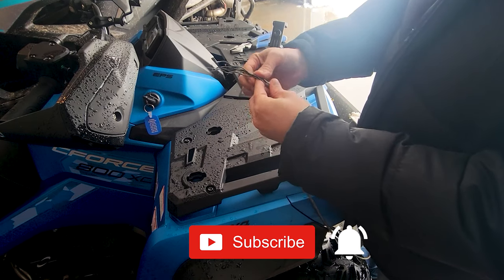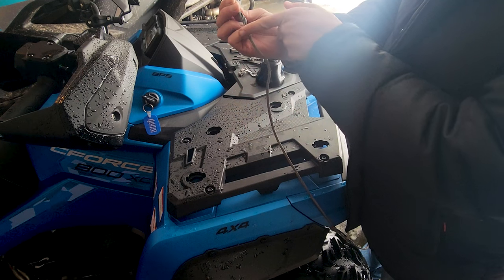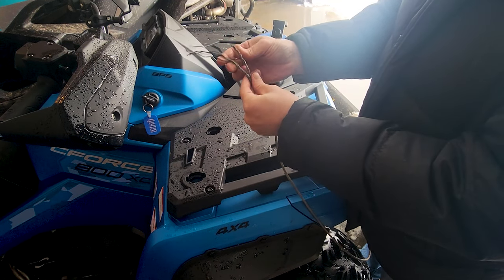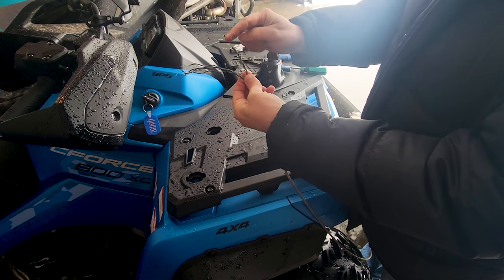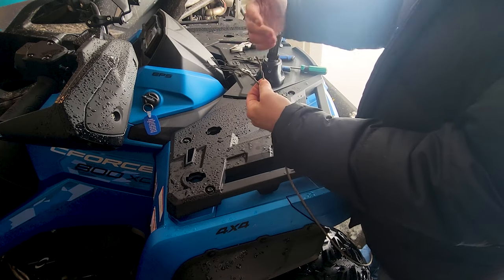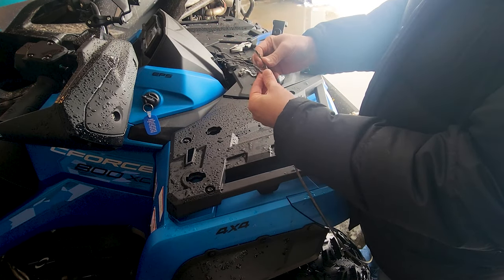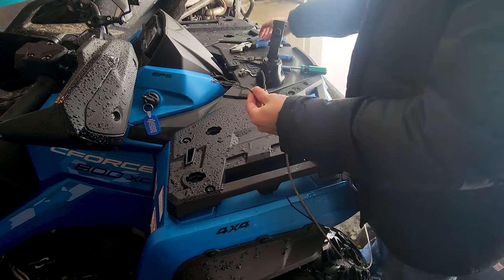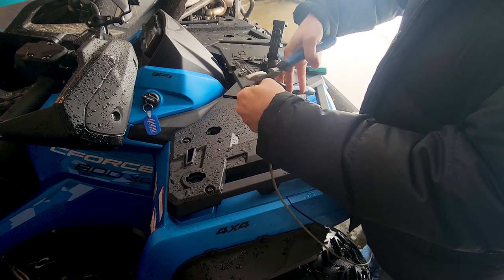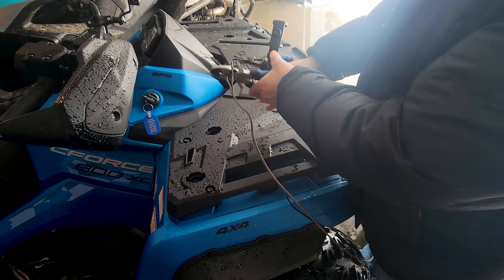First off, the cable is going to start out like what you see down here. It could end up being frayed depending on how it broke. I've already clipped one of these down, but again, with the no tool process, if you're out in the wilderness and this snaps, don't worry about this first step. But if you're at home and you're able to take the time, you can take your lineman pliers and get down to the area where it's frayed.